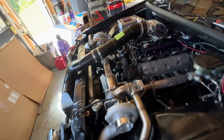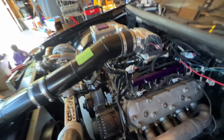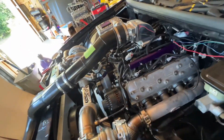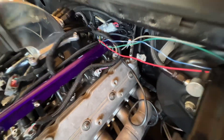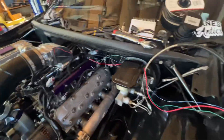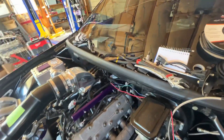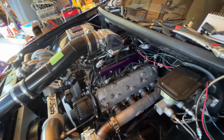Then I'm going to pin it into the DT connector along with the flex sensor stuff. I want to see if I can make the red wire the power wire for the flex, boost control, and related things — or the blue wire, or something else that's pinned on the other side that I can make key-on 12 volts.